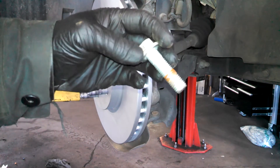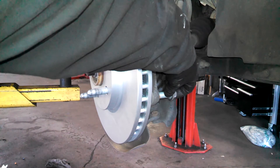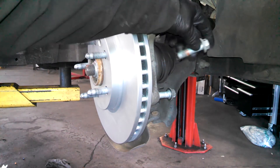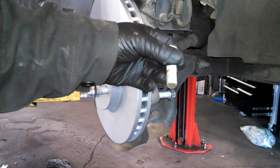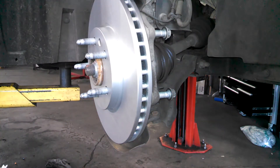They've got a little orange Loctite on here — you can clean this up. If you want, you can buy some Loctite Blue 242, a medium strength Loctite — that'll probably be just fine. My opinion is you don't need it. 140 foot pounds of torque should be enough to hold it on.